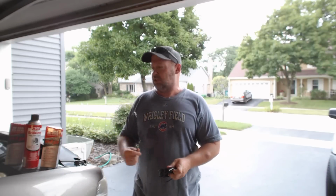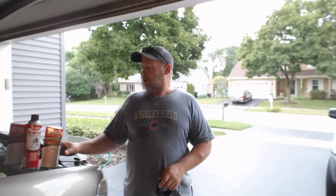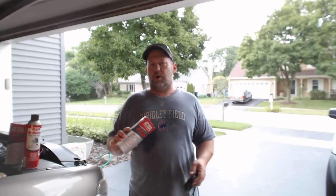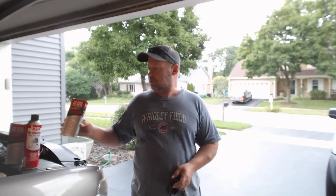And we'll see if we can even see if the rear main seal is leaking or the rear main seal cover plate is leaking. And then I'm going to spray a bunch of brake cleaner in there. I bought 2 bottles of this, so I'm going to take one of the bottles, put it in a spray bottle, and spray around the rear main oil seal and wherever else I can spray with those 2 or 3 access points I have in there. So let me get the camera situated.